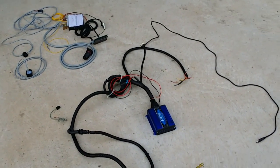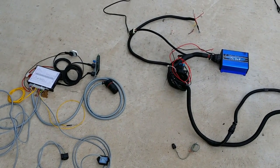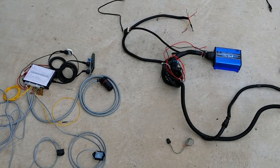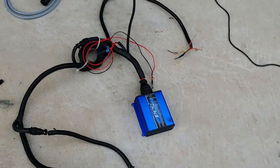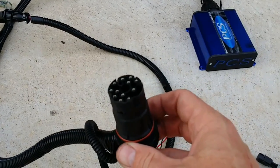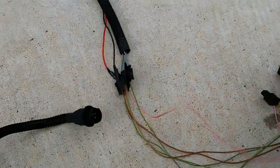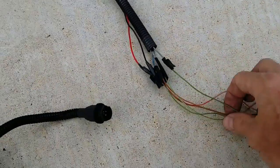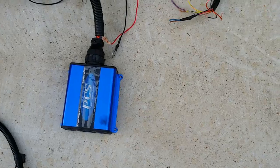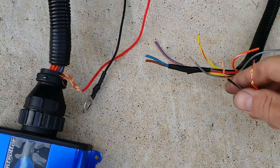This is a side-by-side comparison of the control units. Physically they're about the same size, except the Arduino unit is a little shorter. What I really want to show is the wiring harness. The PCS is a generic interface — I knew that buying it. I bought the aftermarket harness specifically for the 7226, so we got the transmission fitting and the shifter fitting, but I still had to use those connectors and wire them up.